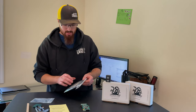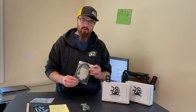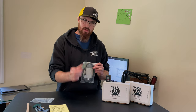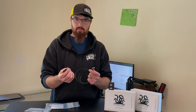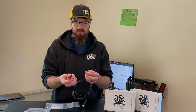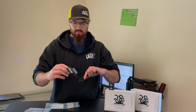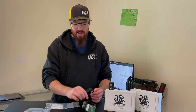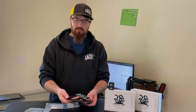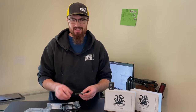This is new — they didn't used to include this — but they now come with a six-foot cable to connect the Hydra to your Windows computer. You can leave this installed in the chip, connect it to the USB port on the chip, plug the chip into your PCM in the truck, and run the cable up under your dash. So not only can you flash the tunes yourself, you can flash them with a laptop without even taking the chip out of your truck.